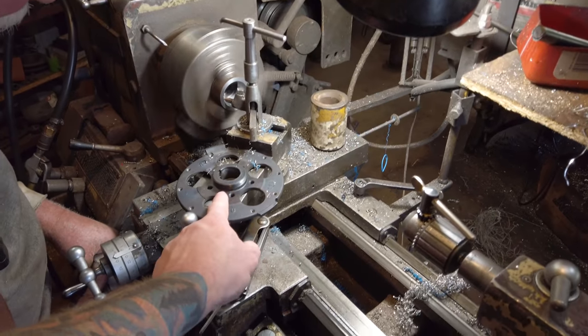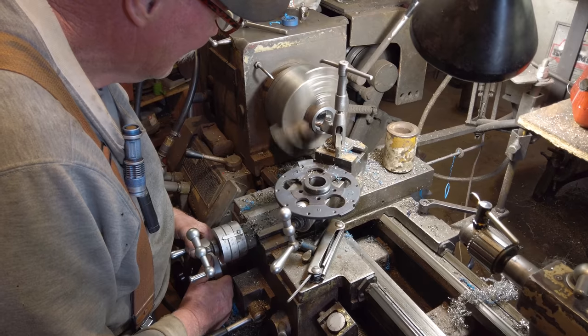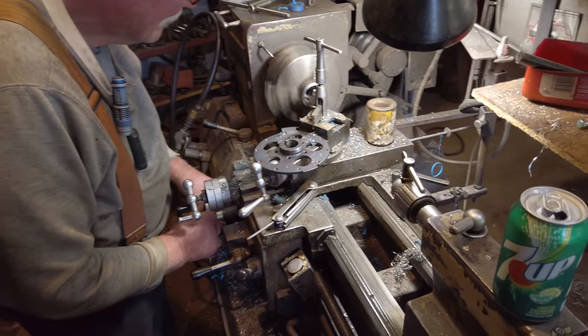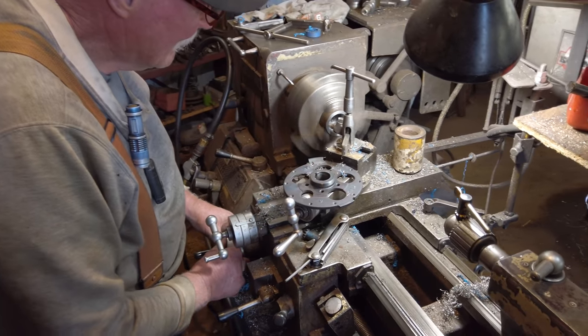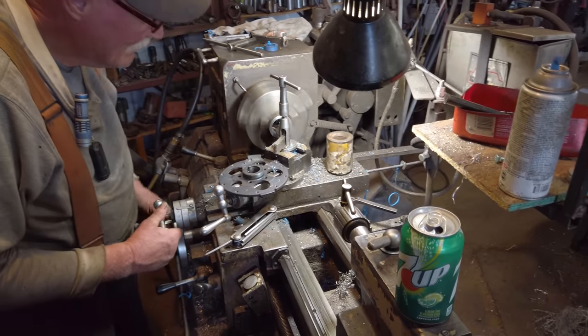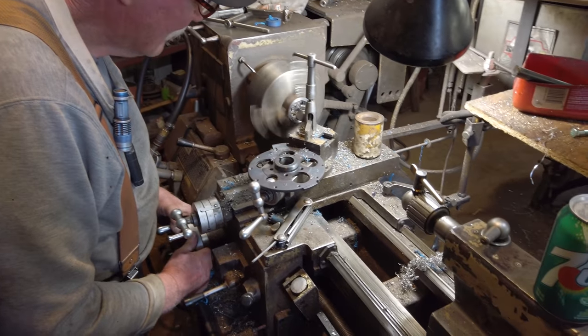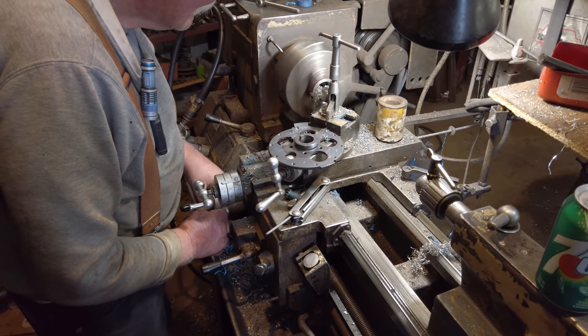I've got an old flywheel here, so we can get the threads off of it. We're going to set up the lathe to cut those inside metric threads, and then we can put a plate over the end or something and cut and tap that for just a regular old bolt to actually do the pushing. So anyway, that's what I'm working on right now.